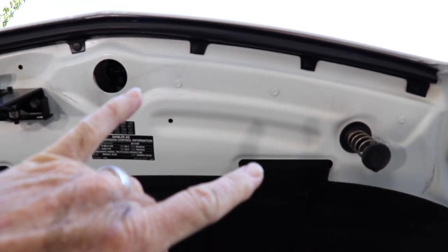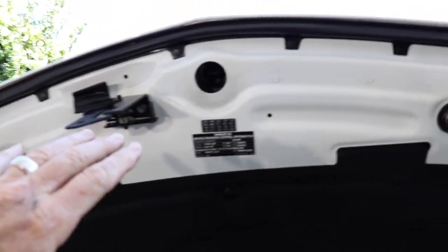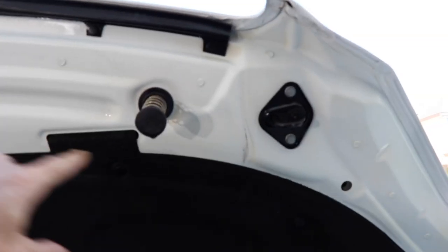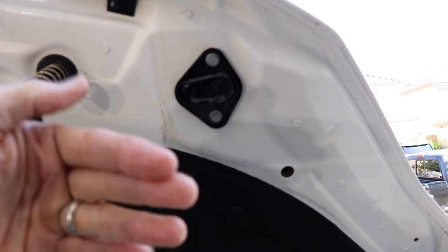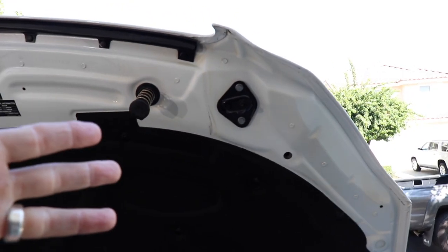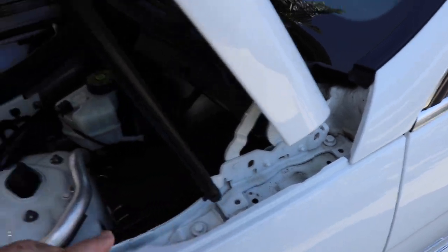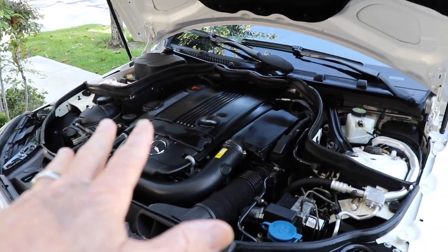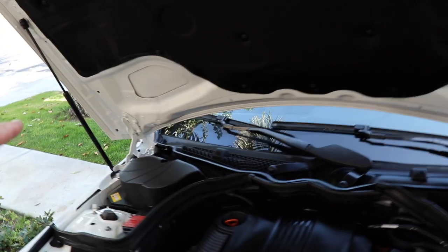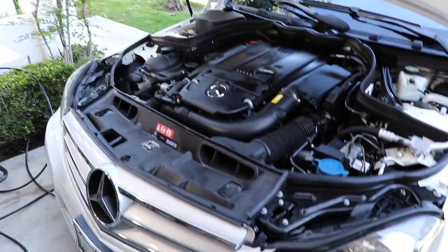This is not a caustic degreaser, so it's really not an issue, but I still have some paint wearing off here and some lines where it butts up against the seam — the paint has worn off there. When the dirt was there it covered that up; now that the dirt's gone, it reveals it. So you need to manage your expectations. There's also still some dripping collecting dirt. After you start the engine and it reaches operating temperature with complete dryness, you may need to touch up areas where water continued to drip or dried additional dirt. No big deal — just address it after the fact.